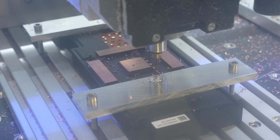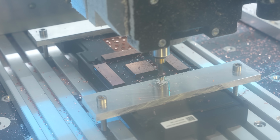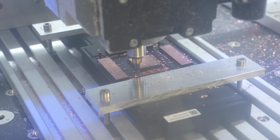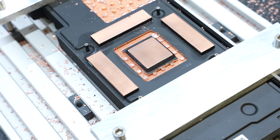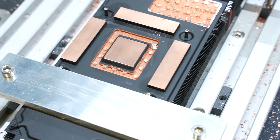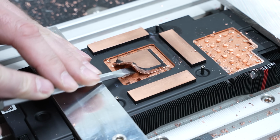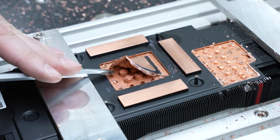Continuing with the GPU area, how is the heat dissipated in here? And will we find the same kind of mesh or structure that we saw around it, or maybe more? That's why we cut another groove around the entire GPU area, because we wanted to remove this surface in exactly the same way. In the groove, it looked exactly like the area previously. Again, because there is a solid connection between both surfaces, we had to use a little bit of violence to separate them, using pliers and screwdrivers to just peel it off.